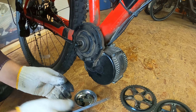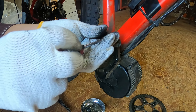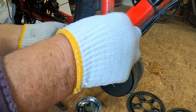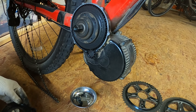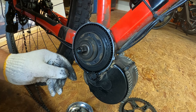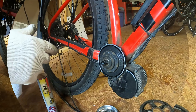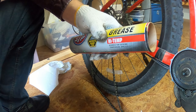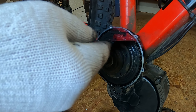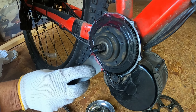Okay, we're down to the last one. Take that spacer off and let's see what we have in here. It definitely looks like it could use some more grease. I'm going to get a couple of paper towels to clean off the outside of this, and then we're going to grease this up. We went ahead — we're just using premium high temperature grease and we're going to try and pack it all inside of here.